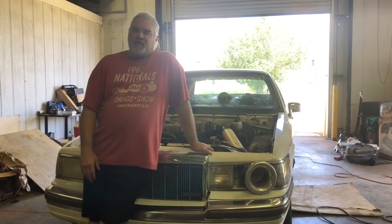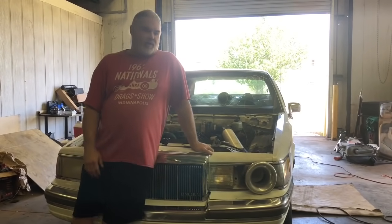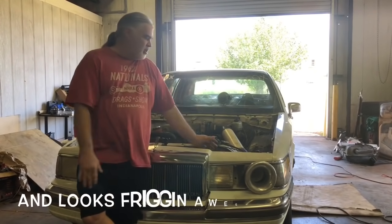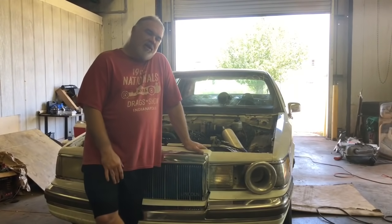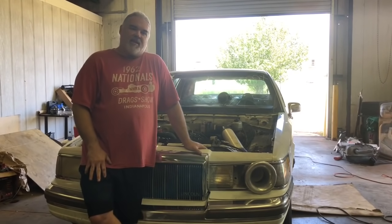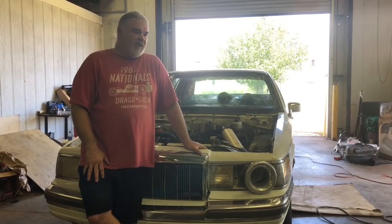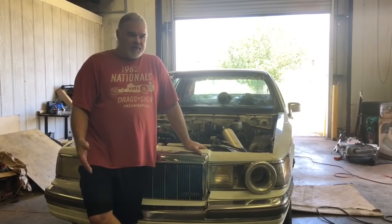So we're gonna wrap this one up. It's really long. But we're pretty happy with the results. We got our boom tube where we can use it, it's functioning. We got our HO cam in, we got our 19-pound injectors, we got our DA1 computer. It all seems to be working copacetic with each other. Runs good, it idles decent, feels a little faster.